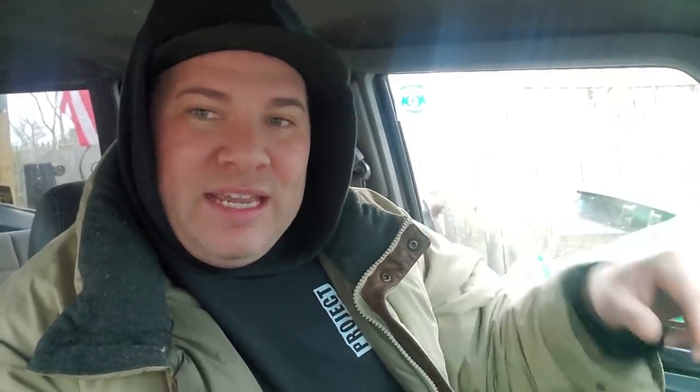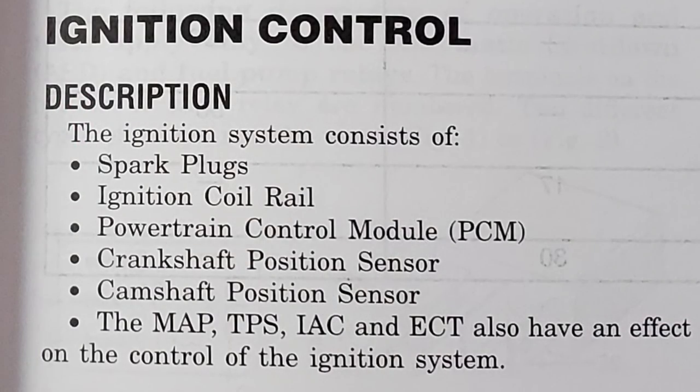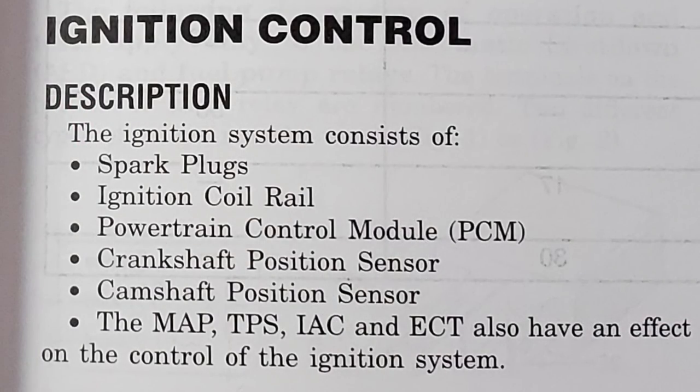Over the course of the last week or so, I've been exchanging some of the parts of this ignition system into the police model to rule out all possibilities. We know that this Jeep starts. So every ignition system component you could think of has been transferred from this Jeep to the police model XJ, except for one more thing - and that's the crankshaft position sensor. But let's go ahead and look at all the other components I've checked out already.